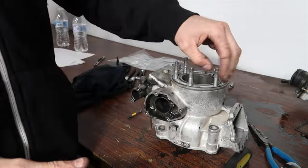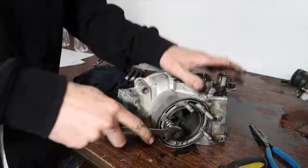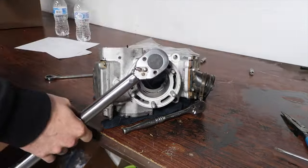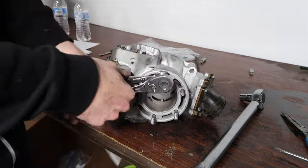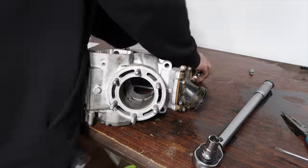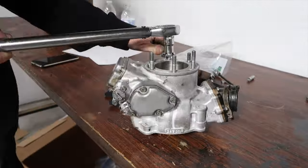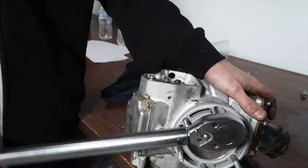The power valve is finished. Now back to the old cylinder. We're going to use two nuts on each head stud to get them off — you tighten them together and then grab the bottom one and twist it off. I'm using a torque wrench for leverage and then installing them into the new cylinder at about 20 foot-pounds of torque. You can look in the manual for the spec. This is the first time I've ever done this — I'm still learning, but everything is double-checked at the end with Joe, who you're about to see build the whole engine.